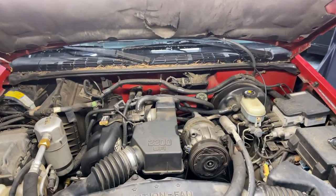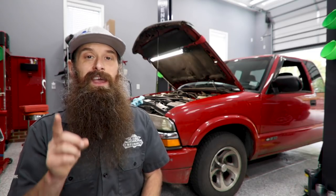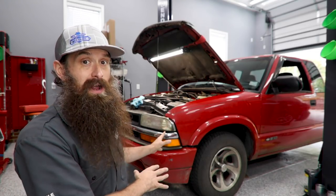What we haven't determined, though, is do we have a bad head gasket only, or do we have a cylinder head that is warped, or even a block that's warped? That's not something we're going to know until we do a full teardown. There are also other ways we can determine whether or not we have a leaking head gasket — combustion gas leaking into the coolant is only one type of failure. Something else we could have done was pressurize the cooling system, or maybe remove the spark plug to see if we're getting coolant into the cylinder. We also could do a cylinder leak down test and see if we had air rushing out of the radiator or coolant reservoir. In this case, though, we pretty much got it nailed, so no sense in doing any further testing until we get the head off.